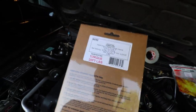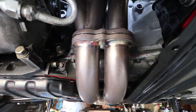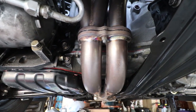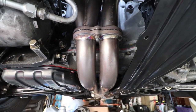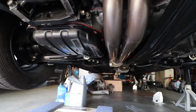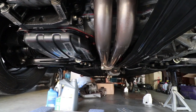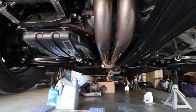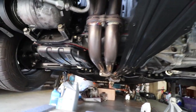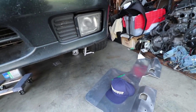There's the gasket all nicely installed. It has a little girth but it's not too substantial — again, the gasket is a little thicker like I showed you, and it will crush just enough to seal up any holes. You'll notice that orange silicone around all the pans — just so you know, that came in the OEM seal kit. That is OEM orange Nissan silicone.